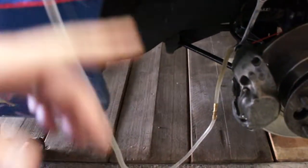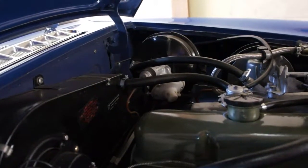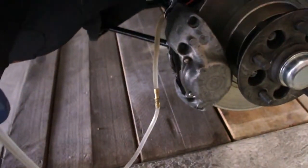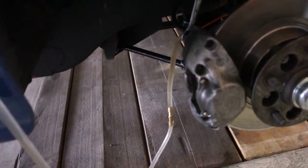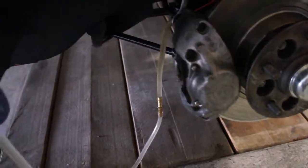There were some air bubbles coming out, and I actually heard some air escaping through something in the servo — it seemed like it was coming from the servo, I could hear air escaping or being pushed through the system. I could hear air bubbles bubbling up inside the reservoir as well. Eventually the brake pedal got stiff again just like it was originally. Now I have a nice stiff brake pedal, the fluid is filling the complete line. My brake pedal is now really stiff just like it was before, and I don't think I'll have any further problems.